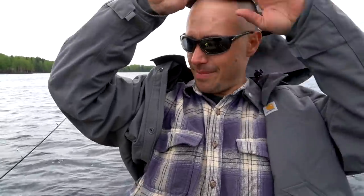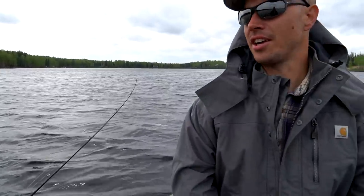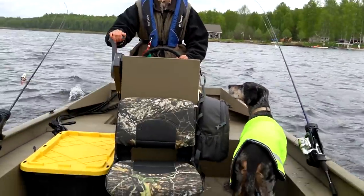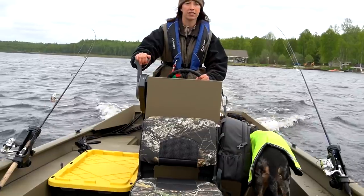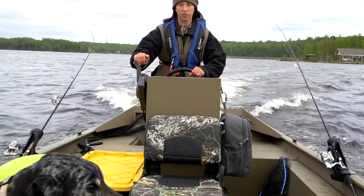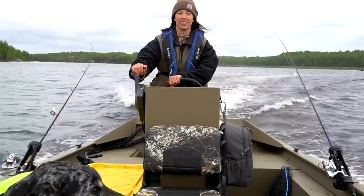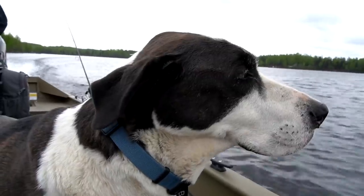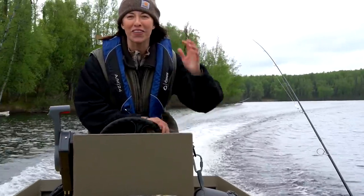Now it's time to have a little more fun — we get to get the boat up on plane, kind of up on step where you're cruising a little higher up in the water. We're going to bring it well above 2,000 RPM, a little over half throttle, get it up on plane, then back it down to just on plane and leave the throttle there and cruise around for another hour. We don't always get the nicest days here, even in summer — it's getting cold, got to get a jacket on — but we're gonna continue ripping around. This thing is smooth, loving it.